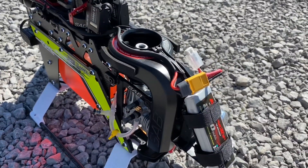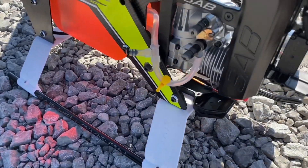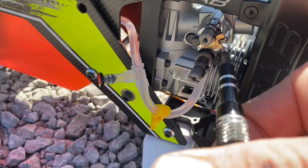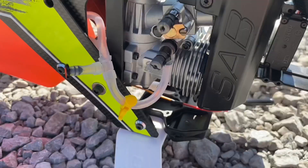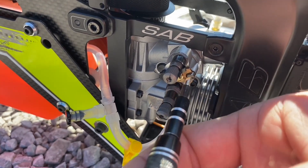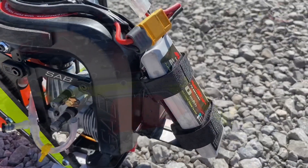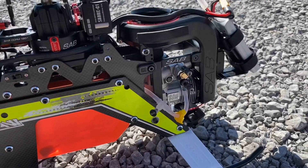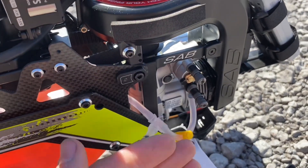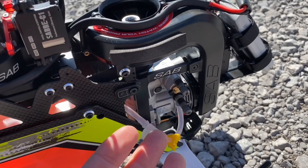We've been idling for about four minutes straight and it has not loaded up. If it does load up, you are going to adjust this center screw — turn it clockwise to lean the mixture, counterclockwise to richen the mixture. Right now this center screw is perfect. Always want to start rich and tune lean — never start lean and tune rich. A lean engine will hurt it; a rich engine will just make no power and have a lot of smoke.